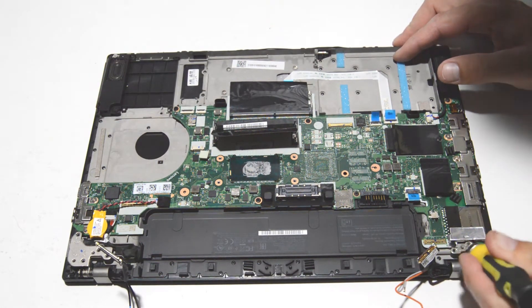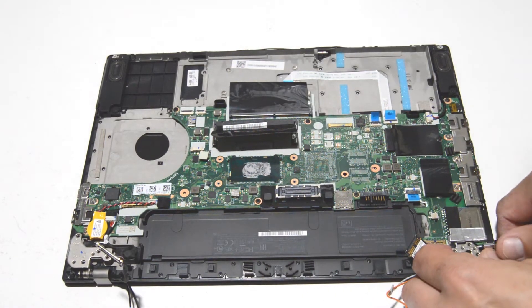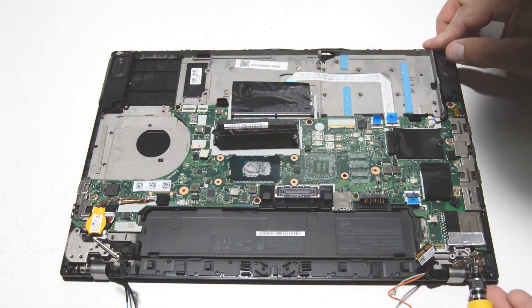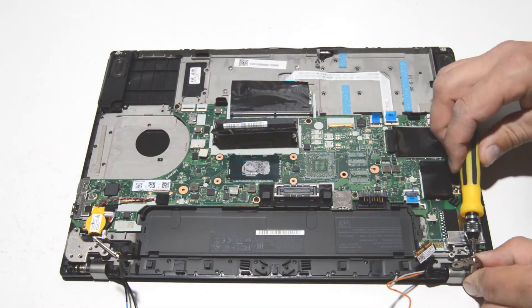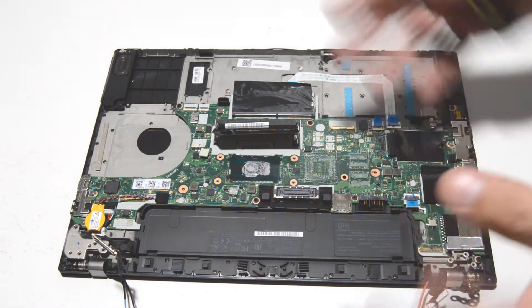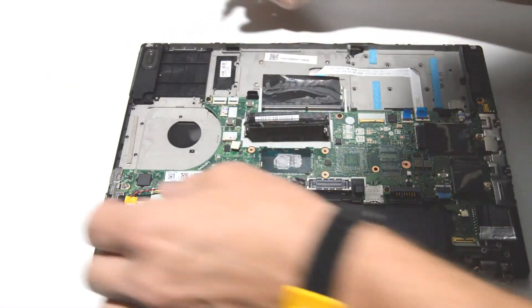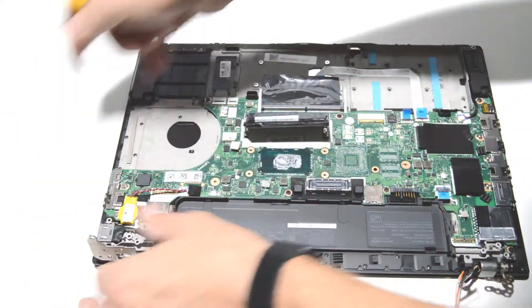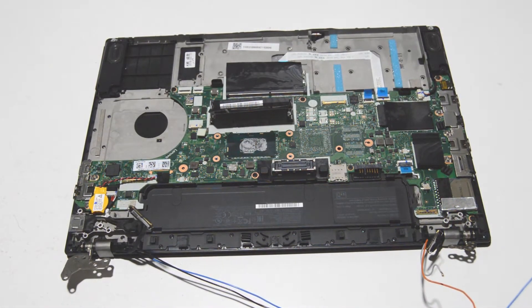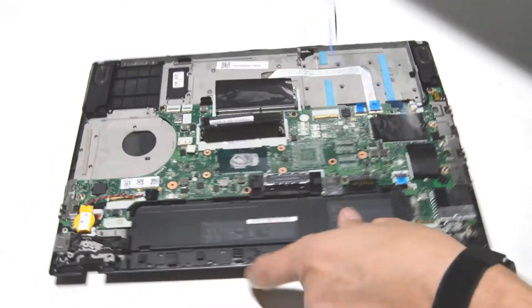You can just poke it through there a little bit and get a head start on moving those hinges. Another way is to leave the hinge screws in and just open up the display and hold it in place while you unscrew the hinges, but this way seems a little easier. With the cables disconnected and hinges moved out, go ahead and separate the rest of the palm rest assembly from the display.